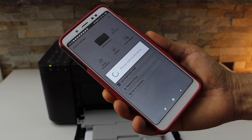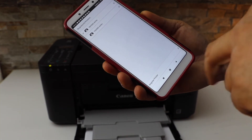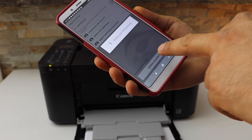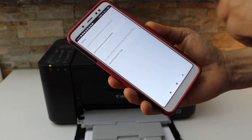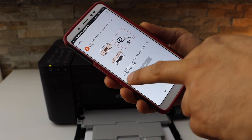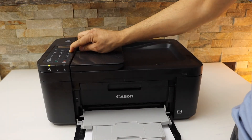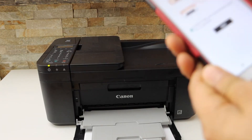Click Add, then Switch Register Printer. If the printer cannot be found, select Auto Connection. Does our printer have a button like this? Yes — so press and hold the menu button for three seconds: one, two, three. Release it and click Next on the screen.